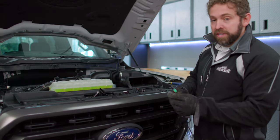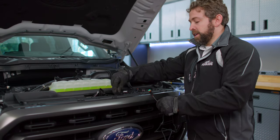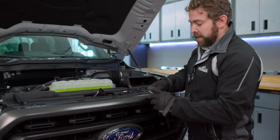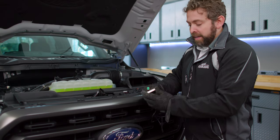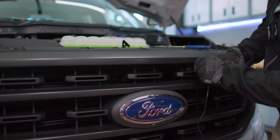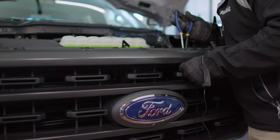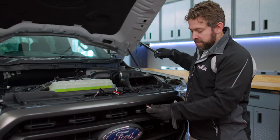The first thing that we need to do is run our lights through this grill here so that we can run the connectors up into the engine bay. Once we get that done, we're going to use our surface promotion wipes to clean our mount areas. We'll remove the protective layer from our auto adhesive grade backing, and then we'll mount the lights directly. So let's go ahead and start with this light here — run the connector through the opening. Your grill variant might be a little bit different, but the overall install is going to be very much the same.